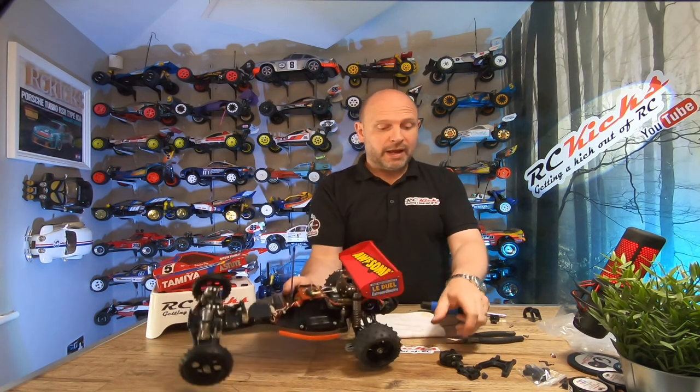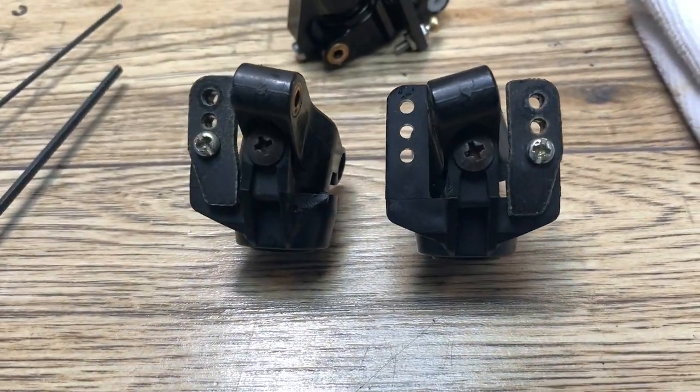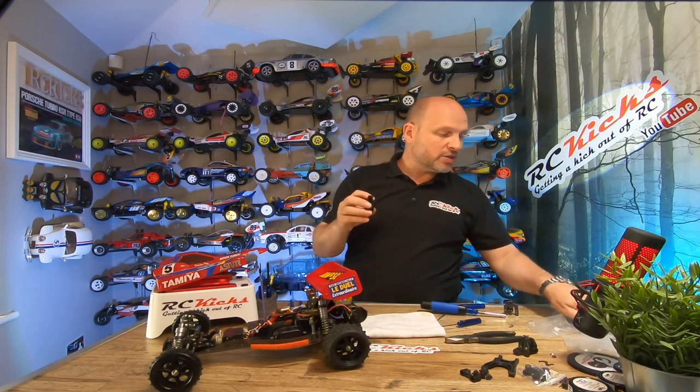That's one side of the rear done. If you can see here — I'll put some close-up images — that's actually missing a section; it should be complete but it's been completely snapped off. Apart from that the actual back section is okay. That was a little bit more difficult to do because of space without taking the gearbox off, but it is possible. I'm still really happy with the rear parts from Jazz Rider. The only thing I'd recommend Jazz Rider to do is they give you some bushings but not enough to do all of it, so you have to decide where you want to put the polyurethane bushes and where to use the old brass ones — and there are no instructions on where to put them. That's the only thing I'd probably do differently.